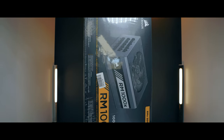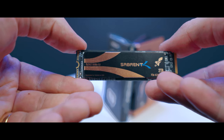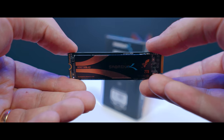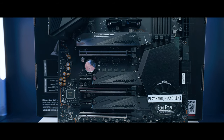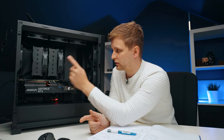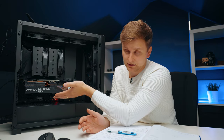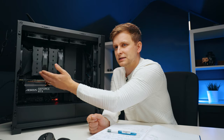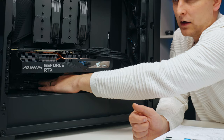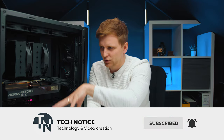We've got a 1000-watt power supply to power the whole system. We're only using NVMe drives — at the moment just one drive, though there are three PCIe 4.0 slots on the motherboard so you could run all at full speed. I placed it in the very bottom slot, which I believe runs through the chipset rather than the CPU directly. Based on benchmarks I don't see any lack of performance. I put it there to move heat further away from the CPU, and it's just warm to the touch, keeping things cool.